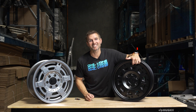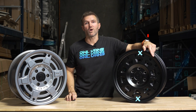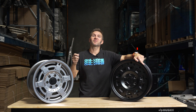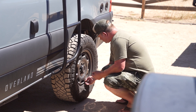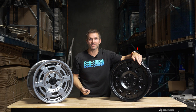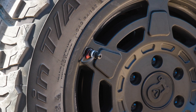The second thing we've done — which was never done before and has now become ubiquitous; it's always nice when the big guys copy what you do — we have two valve stems. A lot of people ask why, and it's because when you go off road you want to air down your tires. It's really hard to do that back and forth of airing down and checking pressure, because you can't check tire pressure while you're airing down since it's constantly changing.